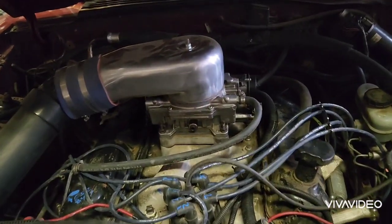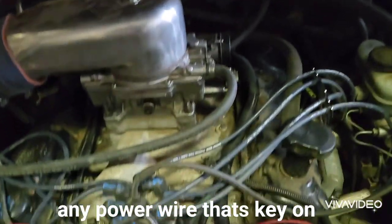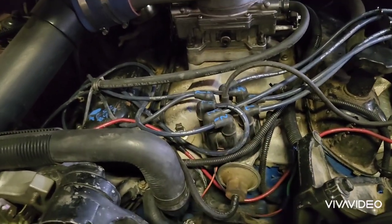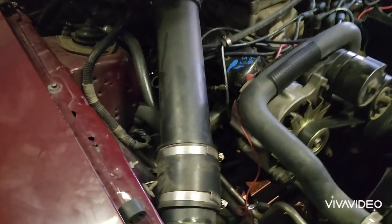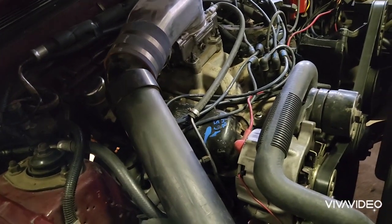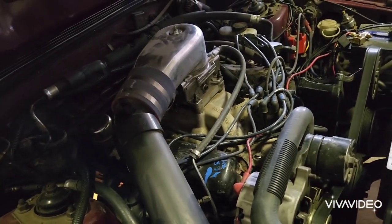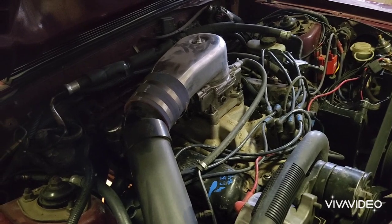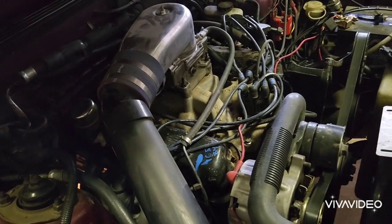This was originally a fuel-injected car and all I took was a power wire and a tach wire off the main wiring harness — that's all you need. The distributor needs power and you have a tach wire, that's it. The mechanical fuel pump was gone since the 302 was fuel injected, so I'm running a Pro Flow lift pump — something you buy at a NAPA or auto parts store — mounted right next to the fuel tank.